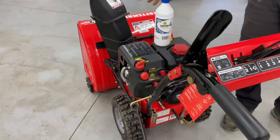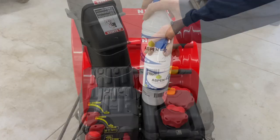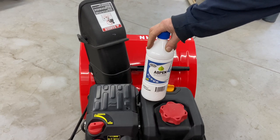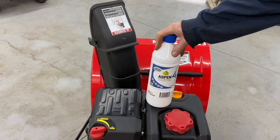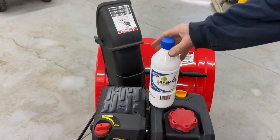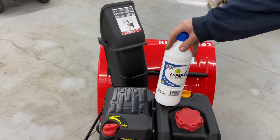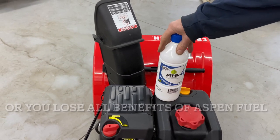This is something I've been using for a few years now and I really like it a lot. This is Aspen Fuel — it's a four-cycle, non-ethanol 92 octane fuel that you can buy locally, most likely at your lawnmower shops in your area. I'll put a link in the description to find someone local. You cannot buy this in box stores as of right now. This is far superior to a lot of the other fuels out there. It doesn't have a lot of the bad stuff in it, it helps for storage, and it eliminates ethanol issues. You most likely will have no more carburetor problems as long as you don't let it sit for more than a few years at a time.